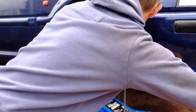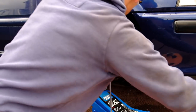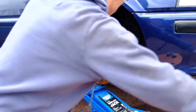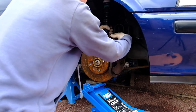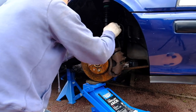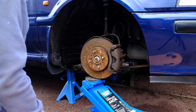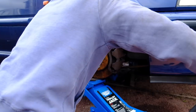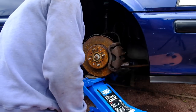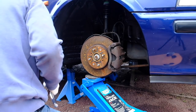Having this on a trolley jack makes it so much easier to manoeuvre it precisely into position — you can get the angle just right on the hub and just glide it up so it takes the strain and you can wiggle it around and get this just right. Perfect. Another twitch and we're good. Let's put the link arm in. Put some copper slip on the drop link bolt as well because I don't want that thing seizing up on me either. There we go — that one is a 13mm.